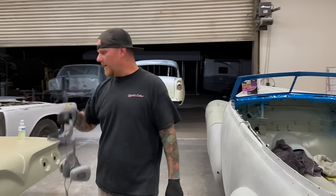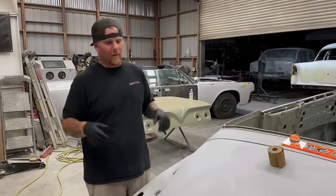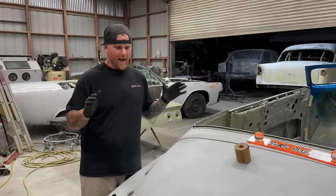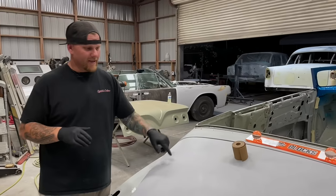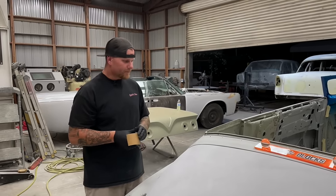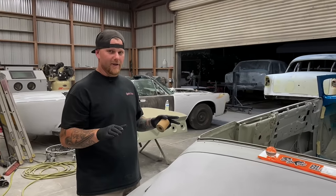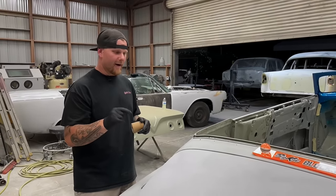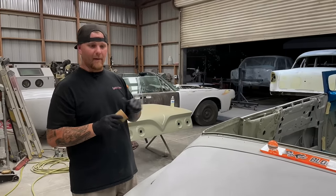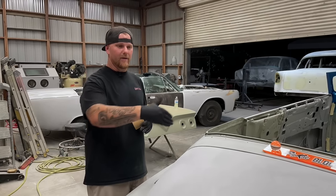You need to be wearing a mask. Ultimately, everything needs to be sanded. We like 80 grit - we are using Sun Mites 80 grit P80. Everything should be scuffed very, very thoroughly. After you blow it off with air, you should see zero shiny anywhere. You should see a scratch in every single nook and cranny of the car that you're going to be adding filler to. We have completely gone through and prepped this car front to back. Everything is ready for filler, it's sitting where it needs to sit. We have now locked the panel in and we can begin doing our body filler.